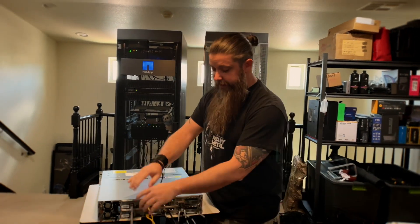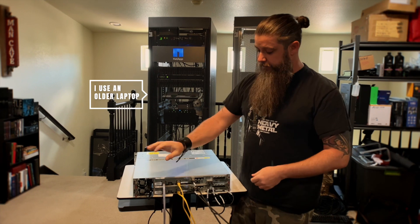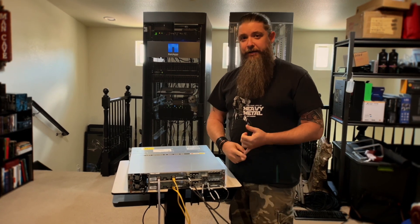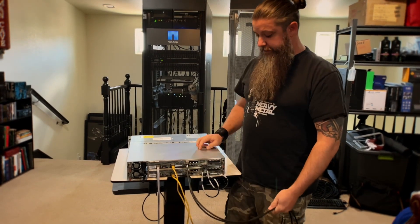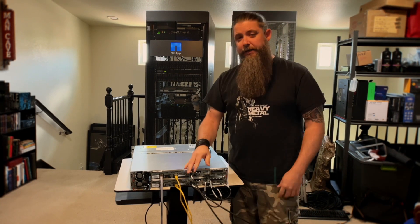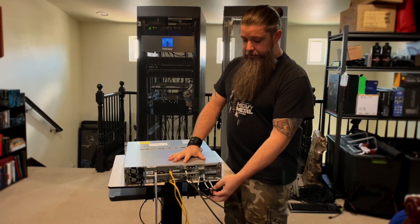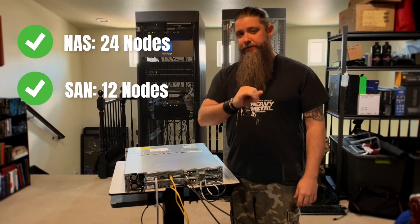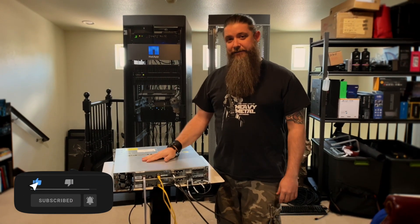Connect your cluster components, connect your management and console ports. Once you get your consoles done, leave those in a jump host or any kind of KVM system you have. In the next video we're going to be setting up our BMC and our service processor — that's a way you can SSH into the console. Don't forget that you have so many connectivity options here. I'm only using Twinax 10GbE here, but you can use up to 25GbE, or use breakout cables with Cisco or Mellanox 100GbE switches. If you've got multiple cluster components, you simply hook these into a back-end switch to scale this up to 12 or 24 nodes.